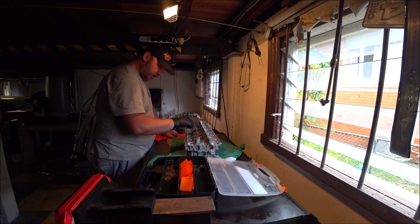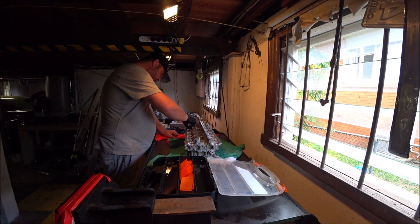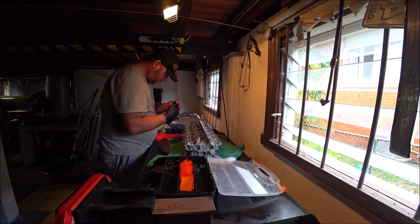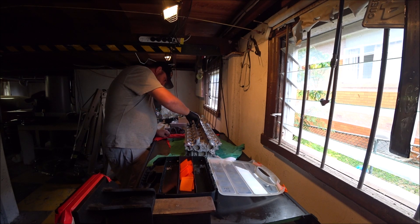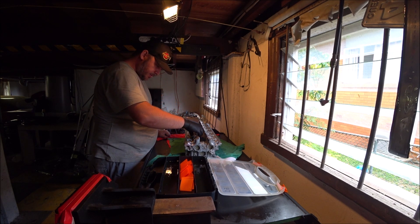I actually pre-primed them all and then realized I couldn't compress them - which would be bad, could bend the valve. So I undid them - well I undid one and kept playing with it until I got it right, then repeated the process for all the others: testing the valve by filling with oil, then disassembling again and pulling the oil out, then reassembling without the thing full of oil - and then doing this soak - to make sure as soon as it goes to start it will be full of oil. It will compress, which means I'll be able to get my cams on.